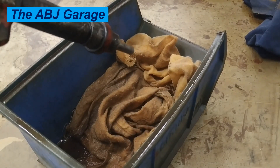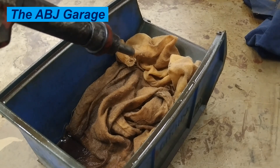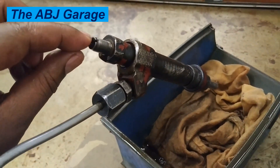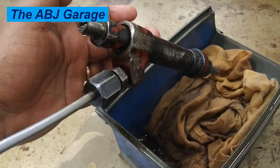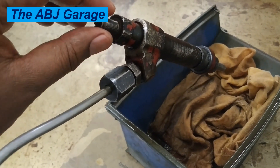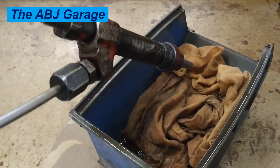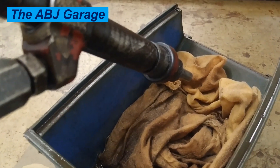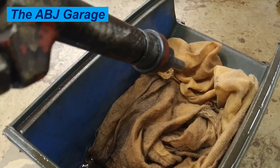For this particular injector, it is opening at 200 bar — that is the opening pressure. If the injector opening pressure is not correct, you can do an opening pressure adjustment using this adjusting screw. When you tighten it, you increase the tension of the compression spring, which will increase the opening pressure. When you loosen it, the tension decreases and the opening pressure will be reduced. Opening pressure test for pintle type injectors can also be done similarly — just pop it and see the opening pressure.